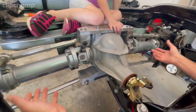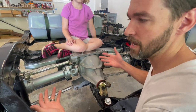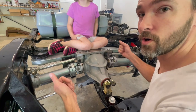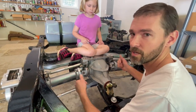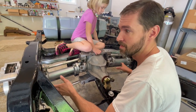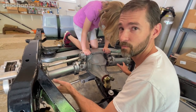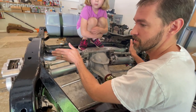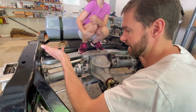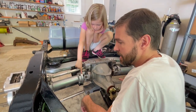One instance that I've seen people run into is when they're jacking the car up and they have some sort of vibration when they're driving down the road. So they'll jack their car up in their shop, crank up the engine, put it in gear to turn the rear tires to see where the vibration is coming from. And when they do that, the whole rear end is just jumping all around like crazy. What's happening is their suspension is fully extended because they've got the body and frame jacked up, so their U-joints end up in a terrible bind.